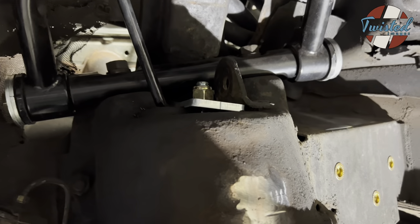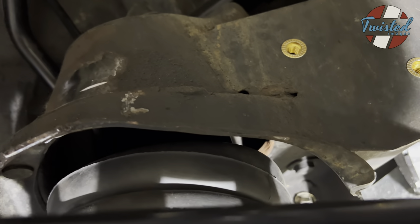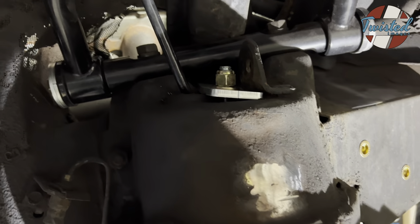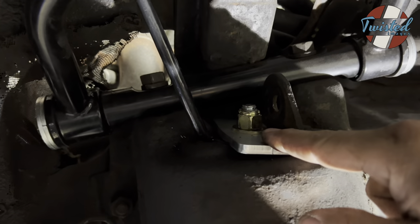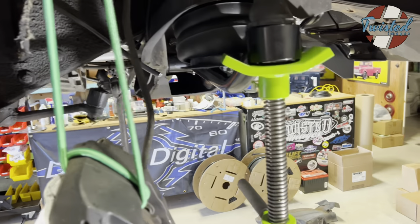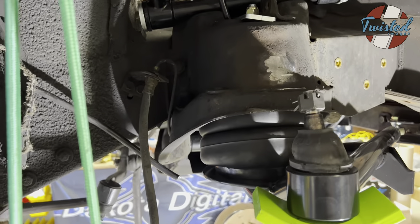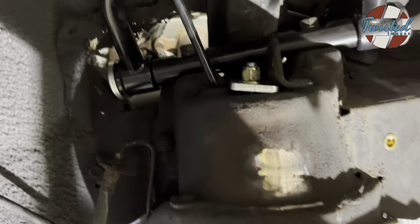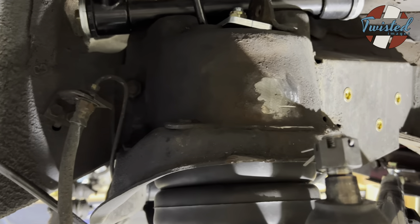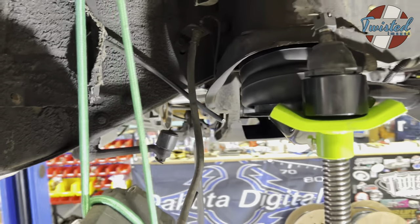What you just saw us struggling with is getting that upper cup in position. There are little fingers on the inside of the pocket that held the coil centered, and the new cup actually engages those as well. So getting it properly centered, getting the stud up through here, getting the washer on, and not kinking the airline is a balancing act. We ended up just using one of the pull jacks and once we got the bag basically in position, just jacked up the lower arm until it popped into place and tightened it down. We've ground off the excess metal so the arm has clearance — I'll hit those with a little spray paint, then it's ready to finish putting back together.